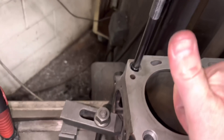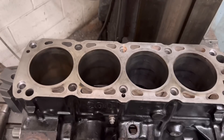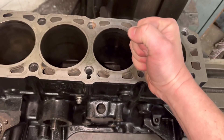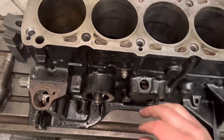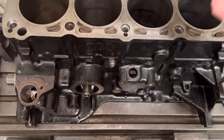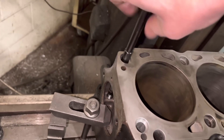You can see that stud sits lovely and flush, and that blue O-ring will just sit straight over there, push nicely into that groove, and seal it a treat. The reason for doing this 10 long-stud conversion is that on high-boost applications with these blocks — most of them are tuned to high heaven — the original head bolts bolt at the surface of the block, and over time because of the boost it pulls up on the block surface. You either get cracks along here, or it blows the head gasket, or both. So we eliminate the stress on the surface by machining down and putting a thread in the base of the block, so the head torques down on the base of the block through a long stud.